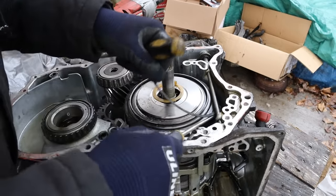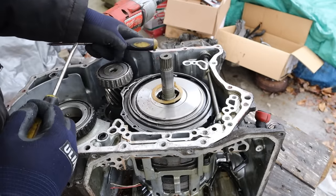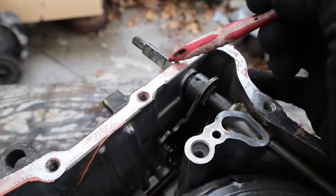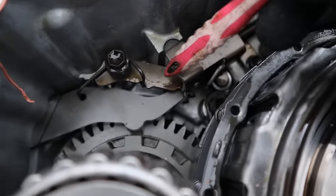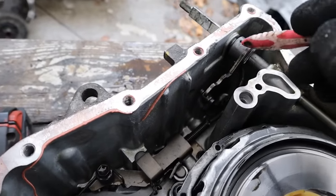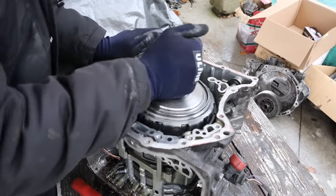There is this snap ring that goes all the way around here — you guys know how I hate snap rings. All of this is being blocked by this little shaft here, which is your gear selector shaft. It goes to the gear selector and then your parking pawl. Now this shaft here comes in and you have the gear selector down there — it's got a spring and then a bracket, and it actually goes to the parking pawl which is going to engage to this countershaft, which then would turn the final drive. I need to remove some of these mechanisms in order to get this piece out, so I can either press this out or chop off the shaft here. Now I should be able to pull this out.